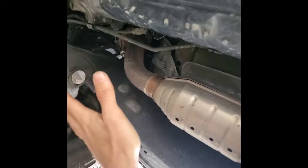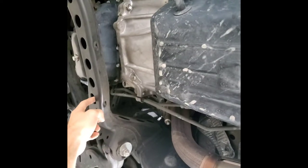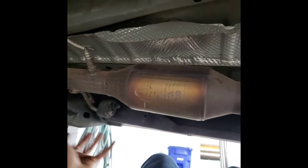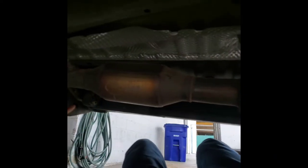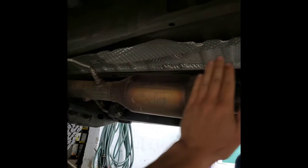I'm going to make a piece of sheet metal that's basically going to look like a skid plate, covering this whole area. It's going to bolt to the frame using two bolt holes that are already here, two more bolt holes here, and then a hole I'm going to through-bolt. For the rear cat, I'm going to make a rectangular shield that covers this whole area and has a four-inch lip that's vertical.